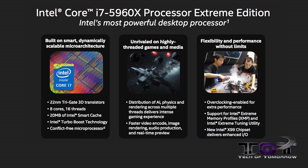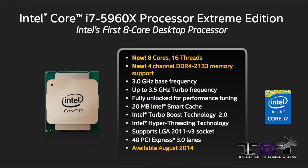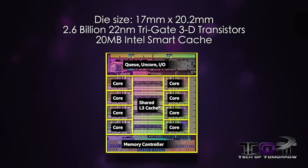Real quickly, in case some of you folks out there just happen to miss it — this is Intel's very first desktop 8-core CPU that's not Xeon. Really big news. The one we're using is an 8-core CPU with 16 virtual threads, so you have 16 threads running at once. It makes this thing absolutely incredible for rendering and crunching. It comes in at 3.0 gigahertz, 3.5 gigahertz on its boost, and 20 megabytes of smart cache. This thing's really geared for hardcore stuff.